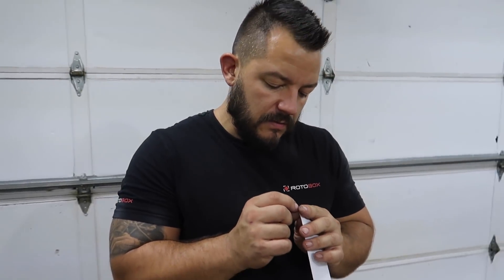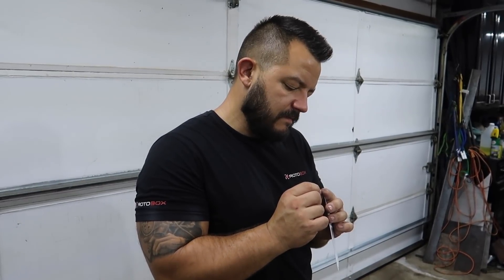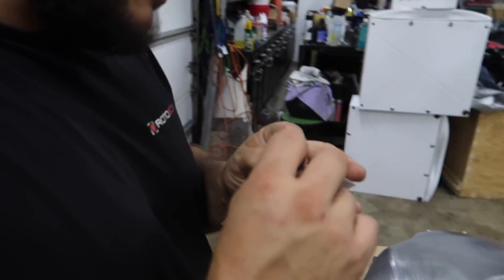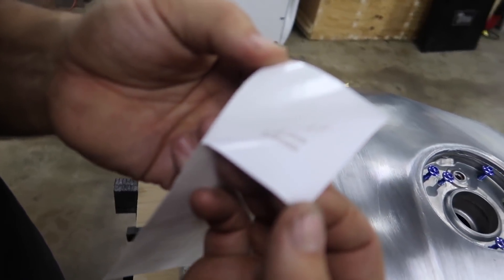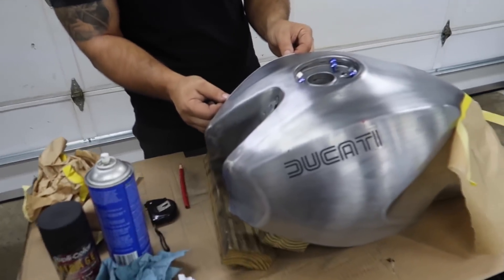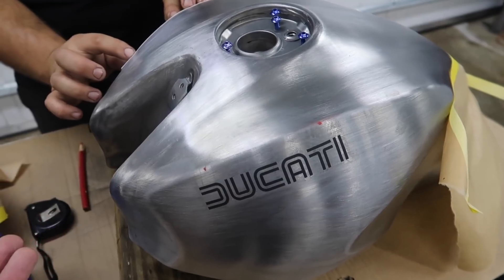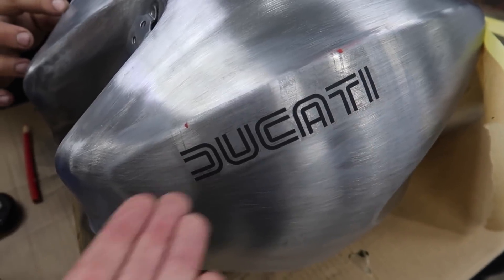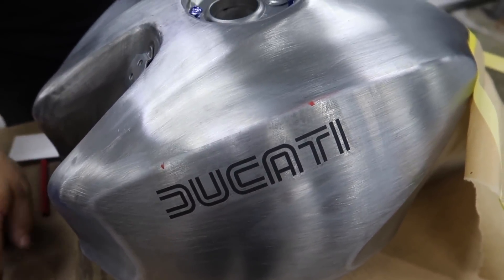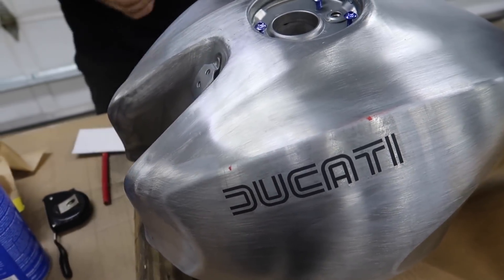So that's what we're going to try to do. He's going to redo the other side off camera. We have one decal left. We're going to let it sit for 24 hours and then try and clean it and see if we can get all the stuff off without peeling the paint off. If that works great, we can clear it then. If it doesn't work, then we have to have new vinyls made — they're really sticky, they should not be leaving a residue like this. It was supposed to be a low-tack vinyl for the stencils and it didn't feel like it when I was peeling it off, which is kind of red flag number one. We're probably going to have to get these remade in a low-tack. So long story short, we're probably going to have to get them remade. We would have been done — we could be clearing it right now. But unfortunately now we might be back to square one: clean the whole thing off, order all new vinyls, and redo it all next week.